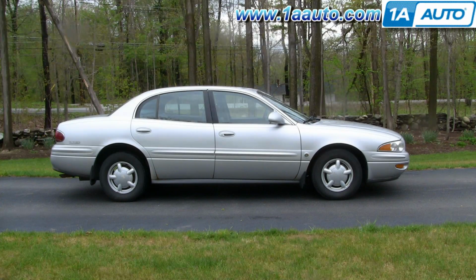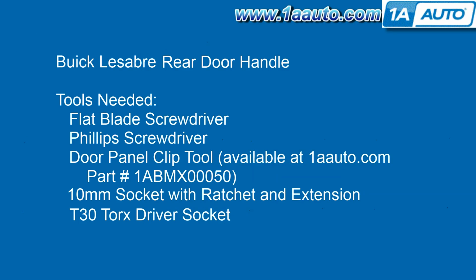Thanks. In this video, we're going to show you how to replace a rear outer door handle on this 2000 Buick LeSabre. It's pretty much the same for most LeSabres, Bonnevilles, cars of this era. Tools you'll need are a flat blade screwdriver, Phillips screwdriver, door panel clip tool, which is available on our website, a 10mm socket with ratchet and extension, and a T30 Torx driver socket. While the procedure is similar for most LeSabres and Bonnevilles, there may be some differences in how you remove the door panel.